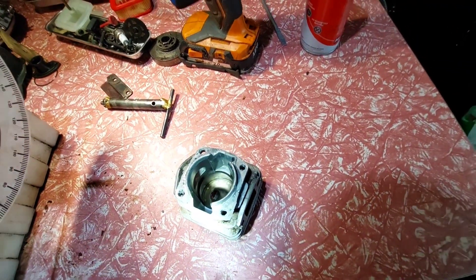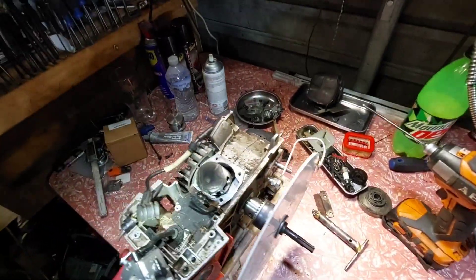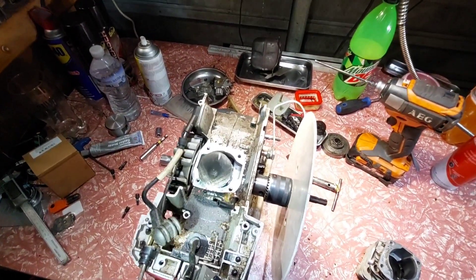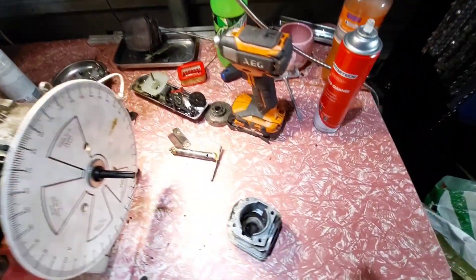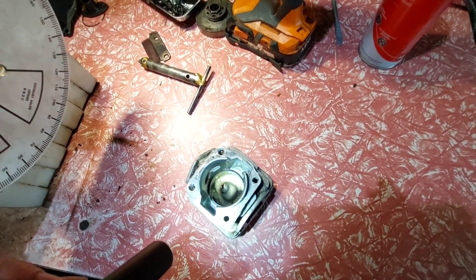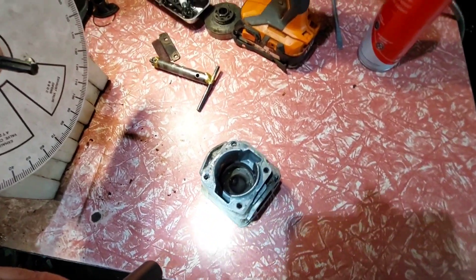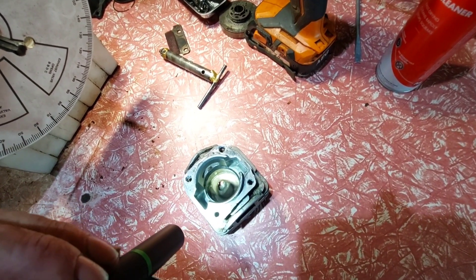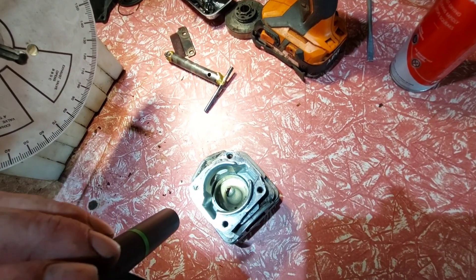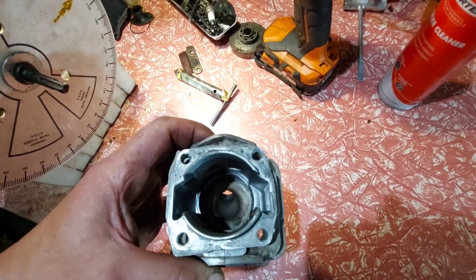So we've got 27 degrees - it looks like that's what this motor is. It's weird. I wanted to know why this motor works well. It's a motor that works well but why - I'm not quite sure. It just performs. I've never seen a two transfer chamber motor work and rev like that. Squish is pretty good, but the last one I did had a huge squish - it was 60-something thousand squish, and I wasn't impressed at all. That was on a Froden. I put Froden in a 62cc crank - 34mm it was - to make it rev. This one here would be a lot of mucking around to do that.